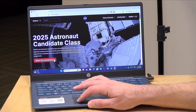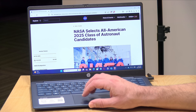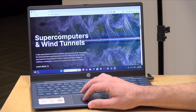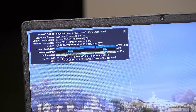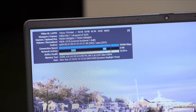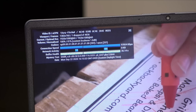Here's the performance — you can see how fast this web page came up; we're browsing nasa.gov over Wi-Fi and it works quite well. It seems to be performing on par with mini PCs running similar hardware. Here's YouTube running a 1080p 60 frames-per-second video — it's not dropping any frames, keeping up just fine. When I only had four gigabytes of RAM, the same test was dropping frames all over the place. The RAM it ships with is barely adequate for Windows today — you'll get more sluggish performance, especially with high frame rate video.